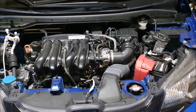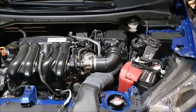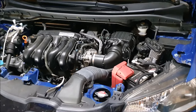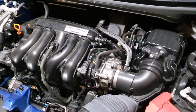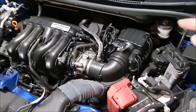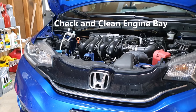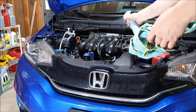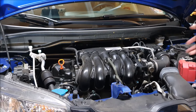So that's the five main things you want to check under your hood monthly in the Honda Fit. It should be really easy — just take you about five minutes and requires no tools — and it should go a long way for keeping your car running good and minimizing any unexpected repairs. I should note there's no transmission fluid dipstick in this car, so we can't check that easily unless we get under the car. There are some other things we could check under the hood, such as the air filter — I do have a separate tutorial on that — but I don't usually check that every month. The final thing I like to do in my monthly check is just wipe down the engine bay with a rag and some water, and I also use this time to check for any leaks or anything that looks unexpected in the engine bay.